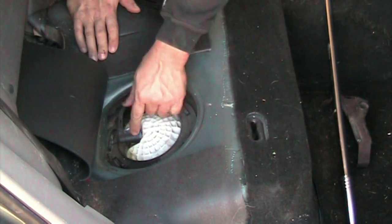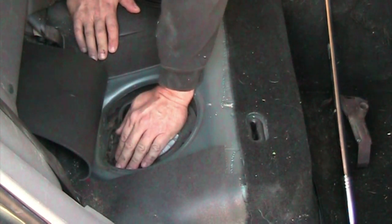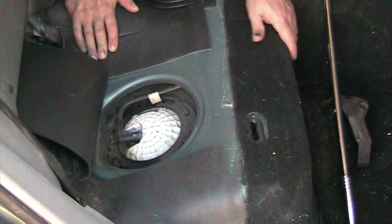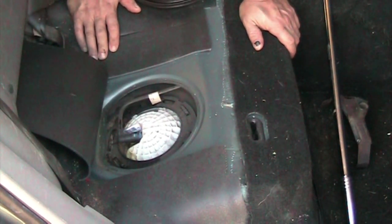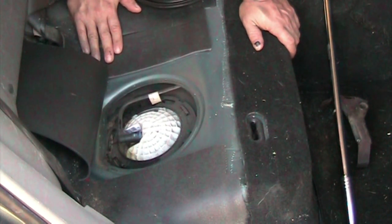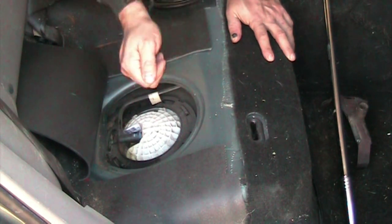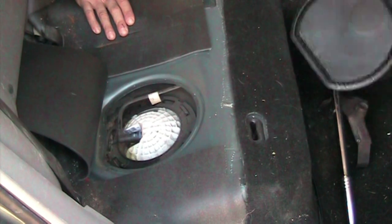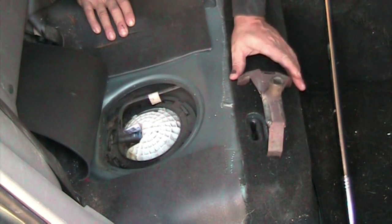This one has seen better days as we can see. It's not the best anymore. From what I understand looking at it, this is actually the unit which has a sensor for the fuel level, but also the filter. And this filter seems to be pretty dirty. So we're gonna take this whole thing apart and replace it with the new unit. Hopefully the car just starts fine constantly, runs fine, and doesn't have the situation where when you start cranking it takes like a second before it starts, because it doesn't get enough fuel through. This also results in better mileage on the fuel, even when it's not that much lower than optimum.